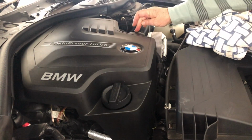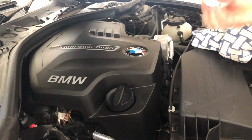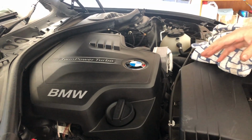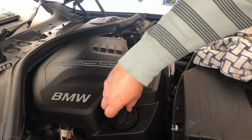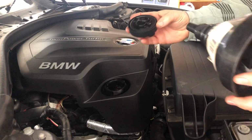So from there, we just put that cover back over again, flick it up like that, and then we turn this around, and she's locked in. This has got the new oil filter in it, the new O-rings on it, and it's sealed back up tight. The new sump plug with the new O-ring is on and in. All the oil's drained out. So all that's left now, two things. One, we put the oil back in, and then we reset up there on the dash.